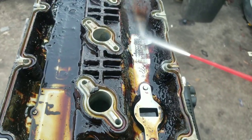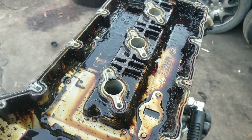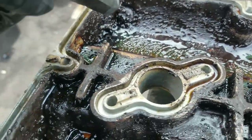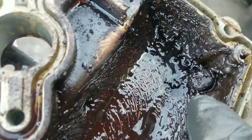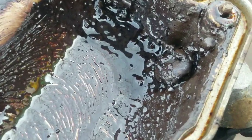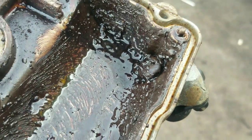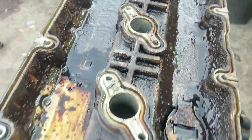See how that comes off? I'm going to go ahead and finish cleaning this and then we'll get to the motor part. One quick note: this in the corner right here is a camshaft position sensor. You want to be careful if you're using a brush to clean that because you don't want to damage it. All that oil built up on it is going to give it a hard time reading the camshaft. You might want to take it off and hand clean it. Some of those things are quite expensive — I bought one the other day and it was $178.